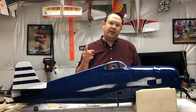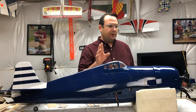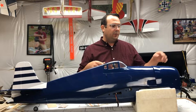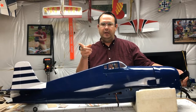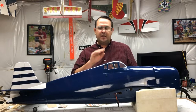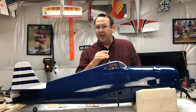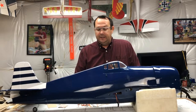The other detail I had to address was the domed prop nut — the aluminum domed prop nut. I didn't know if the one provided by E-Flight would fit this particular motor, so I went ahead and did a 3D-printable nose spinner, borrowed from my Top Flight Corsair. I just scaled it down ever so slightly to meet the appropriate size for this model. I know that it works. Some people are scared off by 3D-printable spinners, but this one is so tiny that it's really not that much mass that's spinning. I haven't had a single issue with the one that's larger on the Top Flight Corsair.